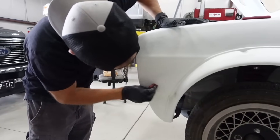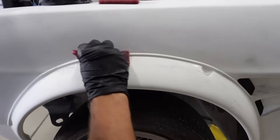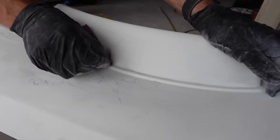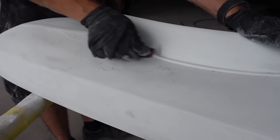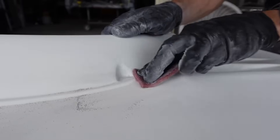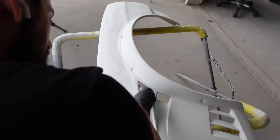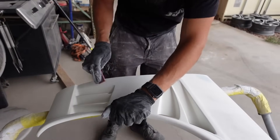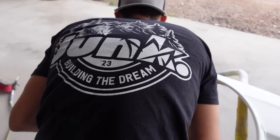Right here we're just sanding the sunny fenders. The fiberglass stuff needs a lot of help. So getting everything scuffed up with a red scotch brite just so the primer has something to stick to. The goal right now is just to get these things in the first coat of primer. I kind of blocked them out - there was nothing crazy that needed filler right away. Getting a nice scratched surface that the paint has something to stick to is essential. It's always the most tedious part of painting - literally just the prep work. Building the dream right there.